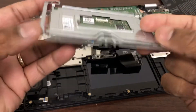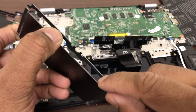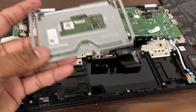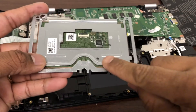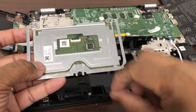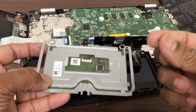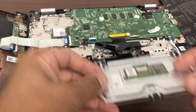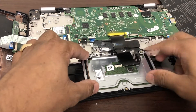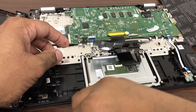There was a piece of plastic that was there, which we cleaned up. All we're gonna do is reverse the procedure we just did. This is the plastic piece that caused the issue. We're gonna plug the trackpad in first, plug the trackpad cable in, put the battery back in, close the back cover, insert the screws, and then we'll test to see how it goes.